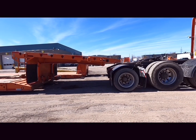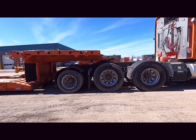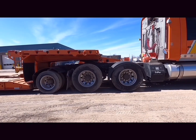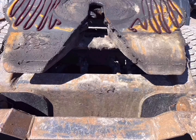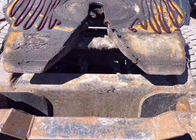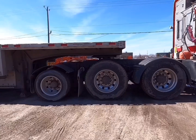If taking a mini deck or double drop style trailer, the goosenecks are shorter and we'll need to back up the fifth wheel all the way. The reason we didn't back up the fifth wheel all the way from the beginning is because we needed to access our hoses. If your double drop is empty, it is possible to back up the fifth wheel. However, if your double drop is loaded or if you're missing good ground traction, I recommend using another trailer.